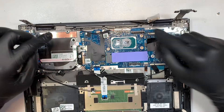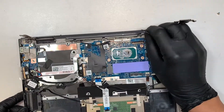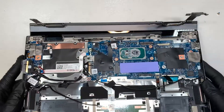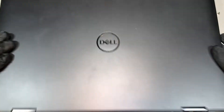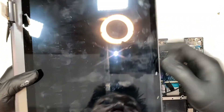Let's take a look — no webcam here. Once you have the two cables removed, you can slide the entire bottom out and the LCD screen comes right out. If you want to do a screen replacement, I highly recommend buying one that's a pre-built full assembly screen rather than just replacing the screen itself, because the touch screen uses double-sided adhesive and it's not easy to remove or replace just the screen panel.